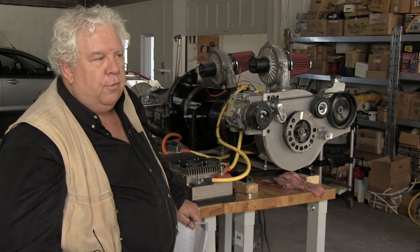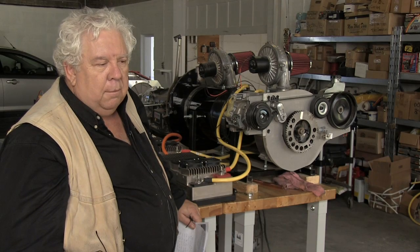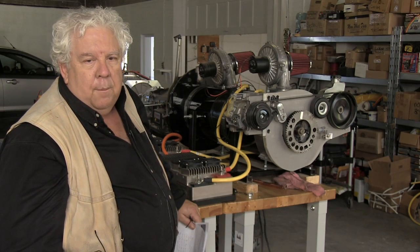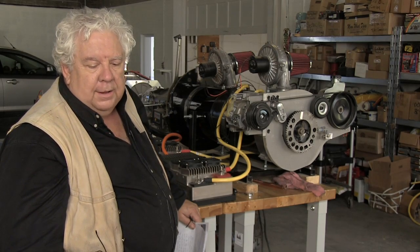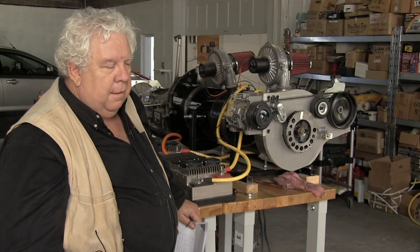That's not a huge problem. People make that out to be a real killer. It's not. You can always put it in neutral and blip the electric motor if you're getting warm, but more importantly, your compressor doesn't really run all the time anyway. It cycles on and off as the demands of the air conditioning dictate.